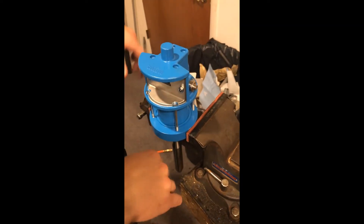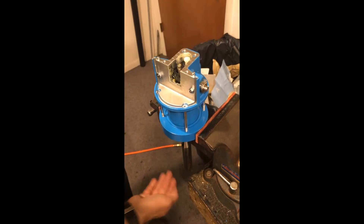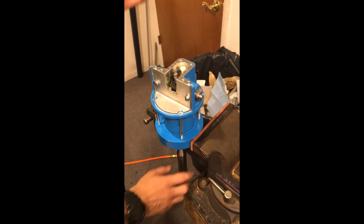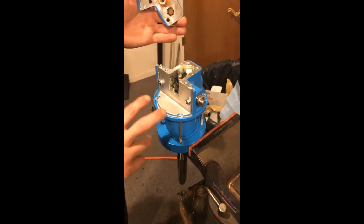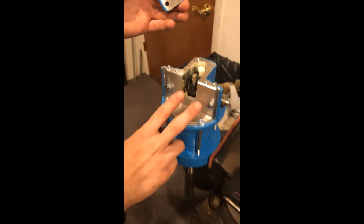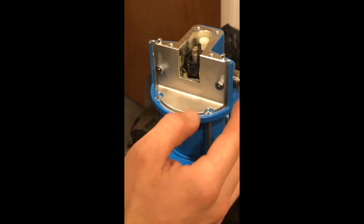Try to put air to it to go one cycle and pull it down. Or if you have the bottom end off like we have here — you'll see how to do that in our other video — you can pull the piston down and put it in the down position. That is to avoid these little rocker arms from popping out of place.